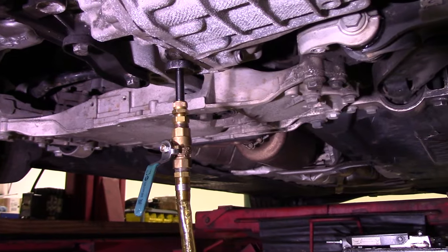Things like oil changes, brake fluid services. Remember, we're going to be pushing our cars a little bit harder than on a daily drive to Target, and we're going to be in the mountains. So we want to make sure all these things are taken care of properly beforehand — oil change, brake fluid, Haldex and DSG fluid. We want to make sure that our brakes are in good condition, with a nice big contact patch between pad and rotor. If you're close on needing brake pads, go ahead and do them before the event.